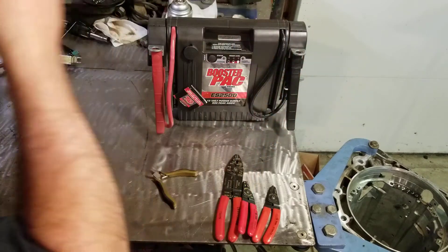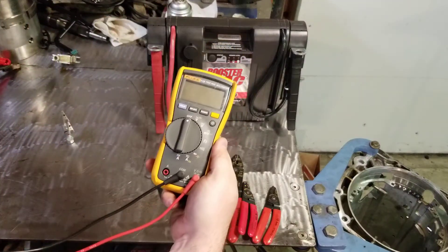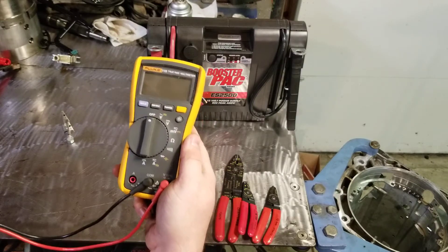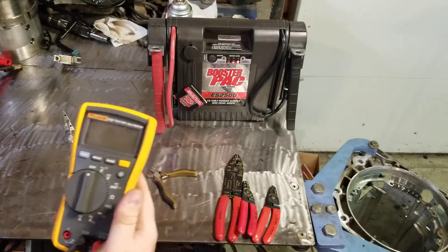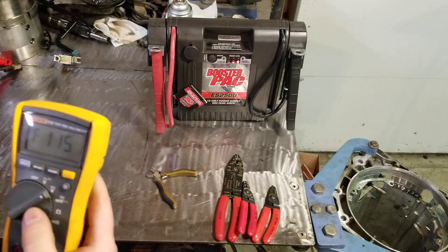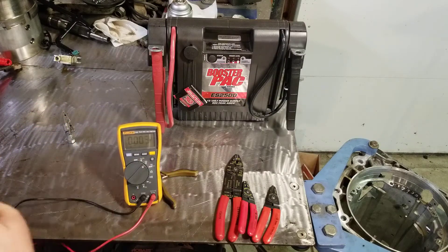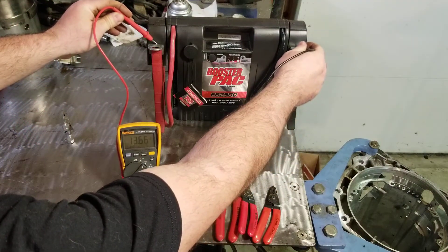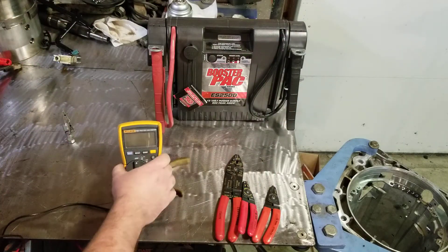Again, this doesn't tell us what the volts are — it just tells us there's some power there. If we want to know the volts, we need a voltmeter. Sometimes they're called a meter, a multimeter, or a DVOM — digital volt meter — lots of different names. I will be doing a separate video on how to properly use this, but if I want to know volts, this is the tool I have to use. You would touch negative and positive, and this jump pack shows 13.66 volts. The test lights could not tell me that — all they could tell me was it's got power.